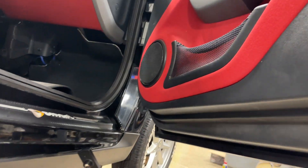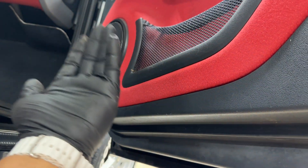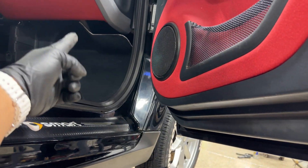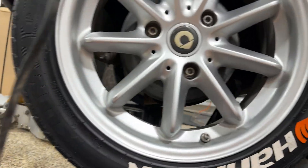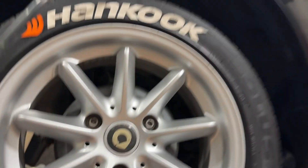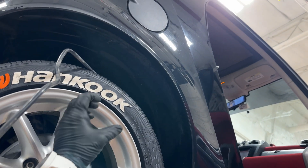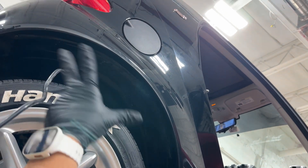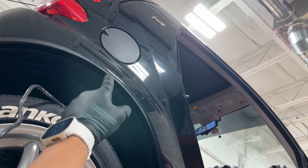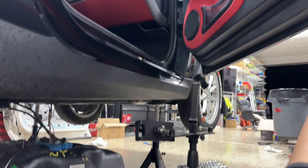The next project is the door speakers — whoever put that speaker in just dropped it inside the door without bolting it up, so I've got to take the door panel off and reattach it. I might also add a subwoofer and an amplifier, which may mean upgrading to a high-output alternator. I also want to redo the grounding — I think there's a number 3 gauge ground from the frame to the motor. I'm going to replace it with a fat cable and hydraulic crimp to improve the whole electrical system. Stay tuned, more stuff coming up.